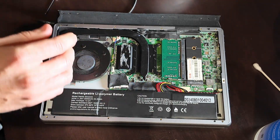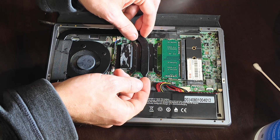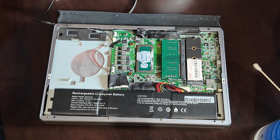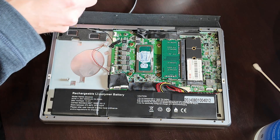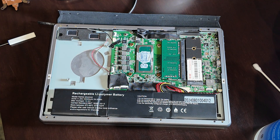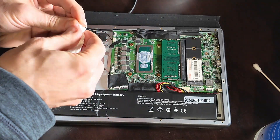There's a little fan cable that needs to come off, and everything else should just lift up and pull out. That thermal paste there is very runny — it doesn't really give me the best impression. This cooling solution also is very likely meant for something a little bit lower end. Let's dab up as much of it as we can.